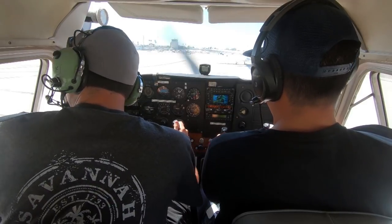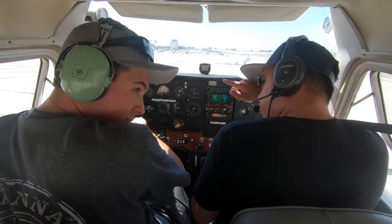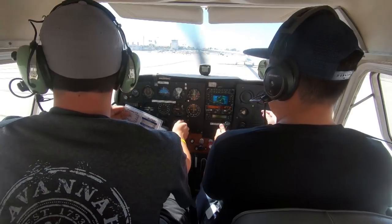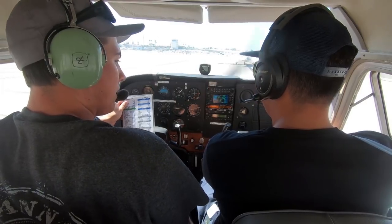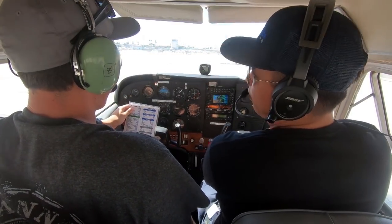So the way you want to check it is like a box, right? Box. Bring it back, look one down, one up on the aileron. Okay. One up, one down. Okay. And just kind of back and glance to the back. Elevator up, elevator down. Right. And we don't want to move the rudder while we're on the ground, right? Yeah, we could, I mean, a little bit. You can check it, yeah, but okay. We already know the rudder's working by just controlling here.